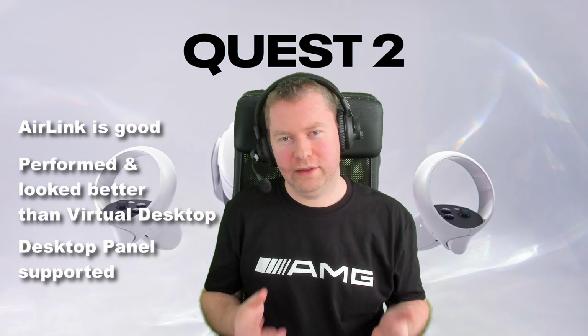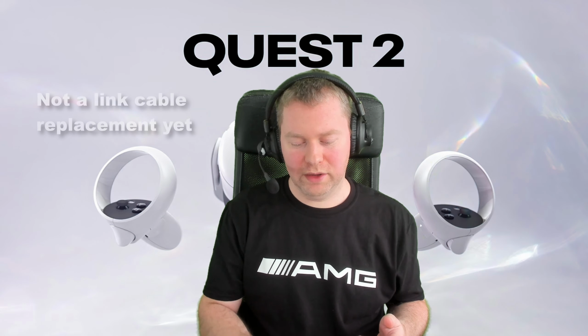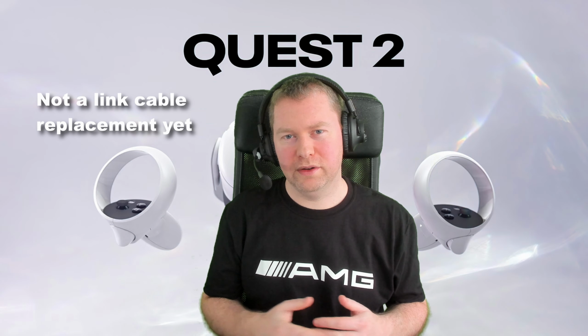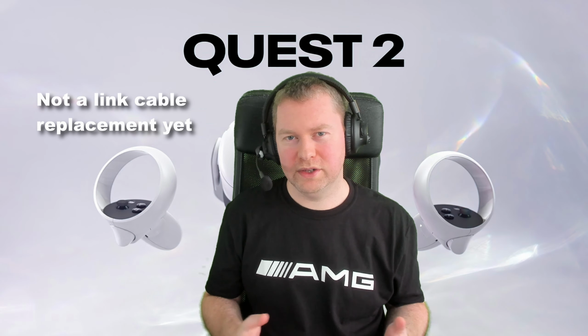So now that we've got AirLink, does that mean we can just get rid of our link cables? I'd say not, particularly depending on the kind of game that you're playing. If you're playing a sim racing game where you're sat down and you're near to your computer, then to get the best visual experience with the lowest latency, I'd say using the cable is still the way to go. And you also get the added bonus of it being charged or keeping it charged, depending on whether you're using a 2.0 or USB 3.0 connection.